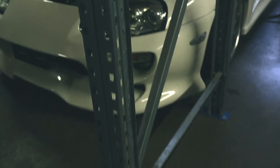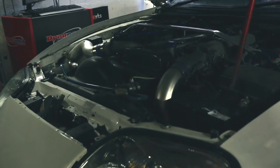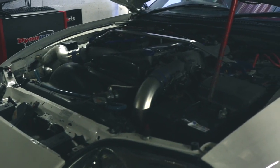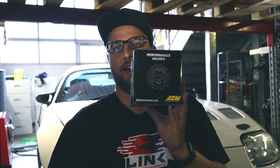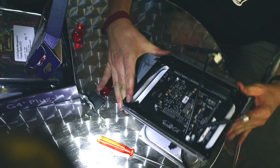We actually realized that the major problem is at the cold start. There's only one way to work around that — we've even tried with a new modern catalyzer. There's only one way to do it correctly and that's going the programmable ECU route. So I had one Link G4 Plus ECU in stock and we're going to use an expansion harness as well, and an AEM wideband sensor and AFR gauge in order to allow us to have precise closed loop AFR tuning possibilities.